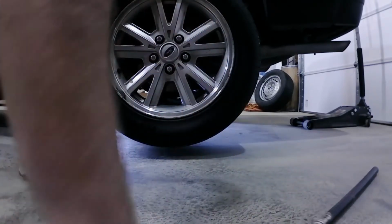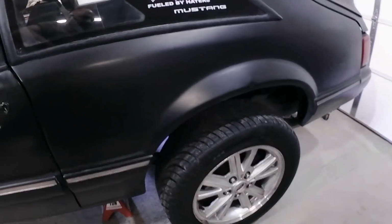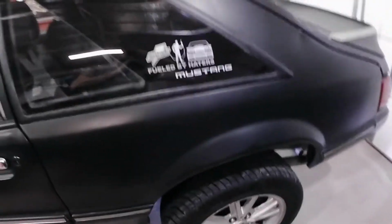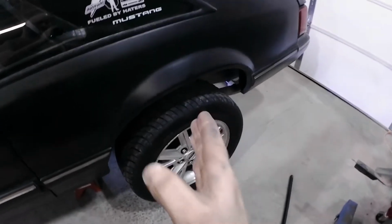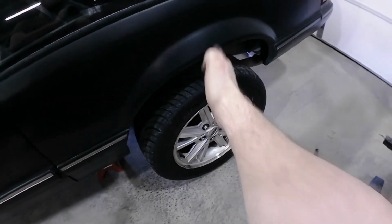But I have some slop in there. Also, of course the clutches are out in a differential, so I might be paying that a little bit of mind too. And whenever I'm cornering in this car, I don't have a lot of oversteer. So that's to say that whenever I'm going around a corner, the rear end doesn't swing around, right? It just kind of pushes through and keeps going straight.